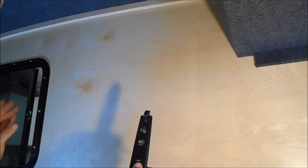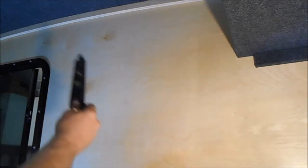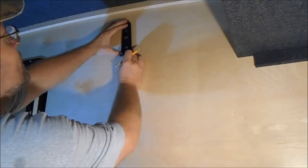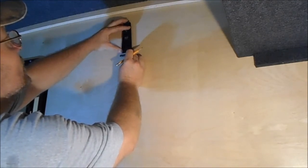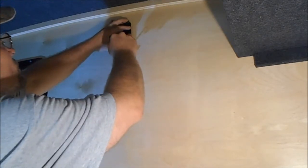The little bracket I got at the yard sale has a little level on it. I took a two-foot bubble level and stuck it inside my camper and made sure it was level from the inside of the camper, because who knows if the tongue is actually level. A lot of people level the tongue, but you should really level the trailer. I'll get my bubble right in the center, straight up and down.